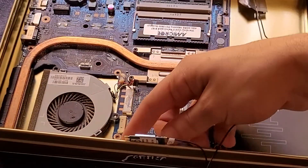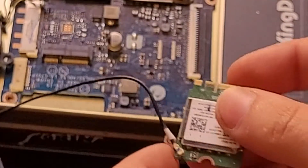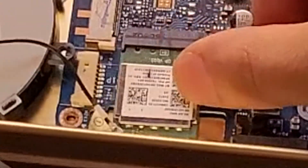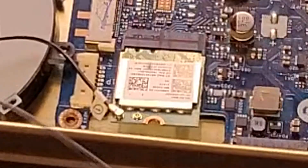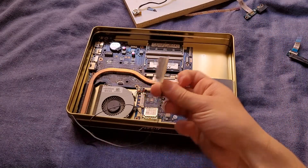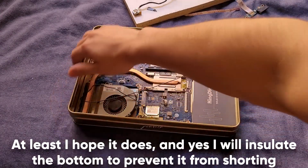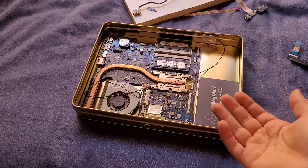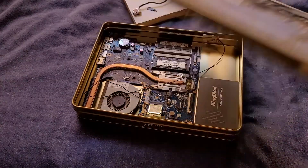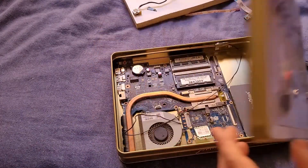Also the network card would go here. There we go, that's plugged back in. And if we just turn this around so it doesn't hit the edge, that should be good. That plugs in, and usually you'd have something that you'd screw on the end here to tie it down. That is still possible - you can do that if I mount something in here. And then this is the actual antenna, so that's the antenna for the wifi. The whole metal box would also act as a conductor for the antenna. So this whole box would become the antenna, and you can even use the lid if you want, which also protects from dust but you can open it up and work on it.